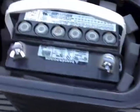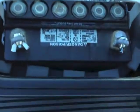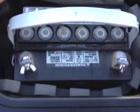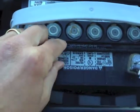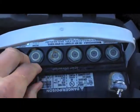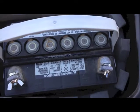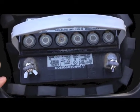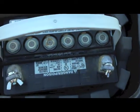So what I've done is I mounted in the bottom of the box here. I use this heavy grade fatigue mat foam to insulate and keep the battery from sliding around. Most importantly, this shock cord — paracord. With this paracord I actually have the battery mounted to a piece of plywood at the bottom of the box. I installed plywood that I cut out to fit so that I could mount the battery to a solid wood platform, then hooked in some clips and used the paracord to secure the battery.